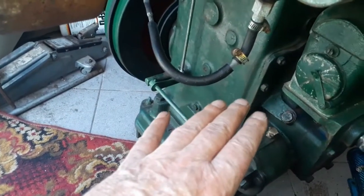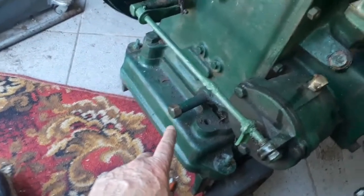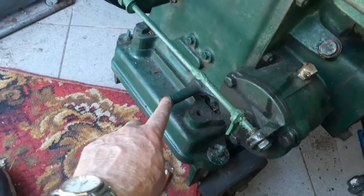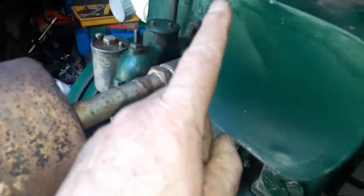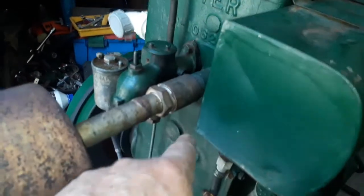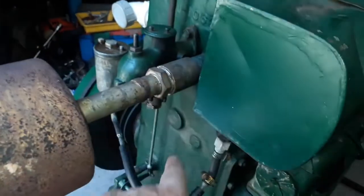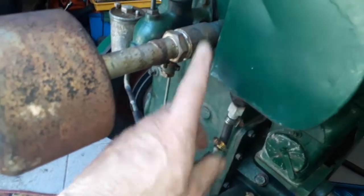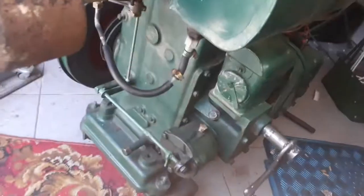So I'm going to let it sit now for the rest of the day. And tomorrow morning, the first thing we are going to do — I'm going to open here. If there's water inside here now, it means there's somewhere a leak between the tank and the sump, because I've put fresh water in. So if there's water tomorrow morning, I've got a leak in the system somewhere. I hope not, but we will see.